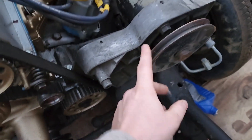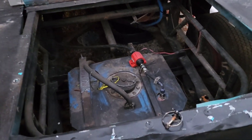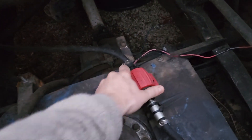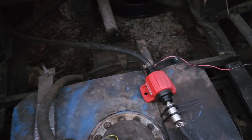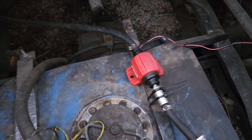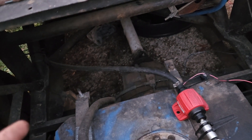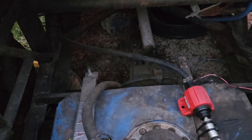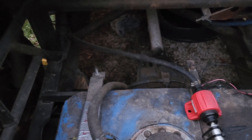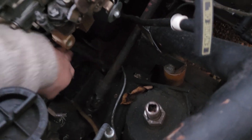We are using that old pulley system because of the belt that's going to run to everything. The old engine has a mechanical fuel pump but this new block doesn't have the slot. I just bought a cheap fuel pump from O'Reilly's off the shelf and zip-tied it in place — we're going to see how it works, could be a fail. I have metal zip ties in the car so I'll get one on there so everything stays in place if something starts to come apart. I need a little bit longer hose but I didn't change it. We're about as tight as we can be on this fuel line where I feel safe with it.